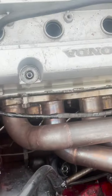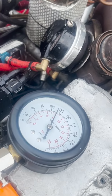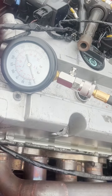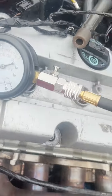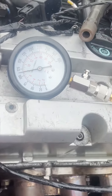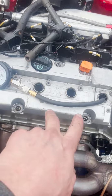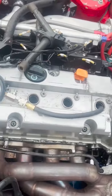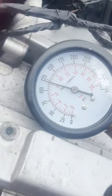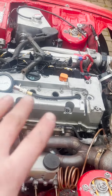Cylinder number four. Let's go and check the rest of these. Cylinder number four. Number two - still looking good. And number one. Sound. So we've got some are down maybe five to ten psi. Potential is that they're the ones that head gaskets have gone on, but I am happy that they are equal throughout all four. There's lowest compression compared to most like a standard K series, but got to remember, these are really low compression pistons because I'm going for high boost. That's why I have the compression so low.